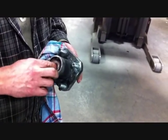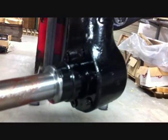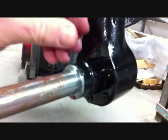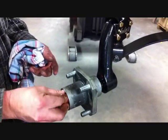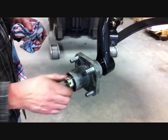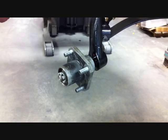Now we're going to get ready to reinstall the hubs to the spindle. It's always a good idea to check your bearings and grease them before installation, and add a little bit of grease to the axle. All the spindles have holes pre-drilled in them so that if you ever wanted to add our hydraulic front brake kit, all you do is pop off the plug — the holes are threaded — which will allow you to put front brakes on this car and increase stopping power three times. Using the stock hardware, reinstall the hub to the car. If your stock hub had the plastic dust covers, you are going to want to use our supplied slotted nut and cotter pin instead of the stock nut, and that is for cars 2004.5 and newer with the plastic dust cover.